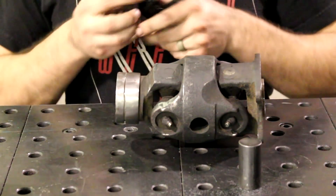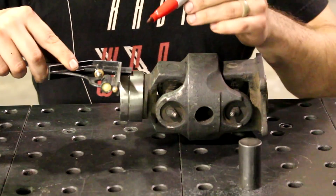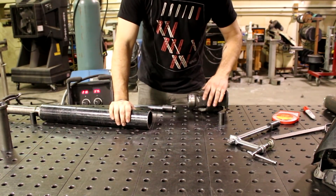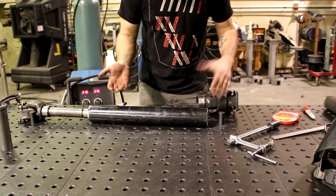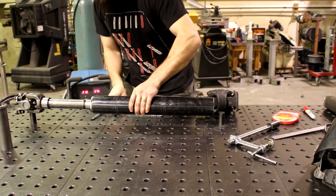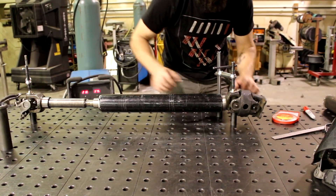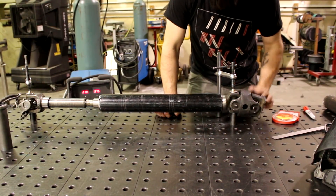Let's put the other end on. On the double CV side, to ensure that this is going to sit in the pipe level and not be off-center, we're going to take this, set it to a half inch, and mark a line all the way around here with red sharpie. A very important thing when building a driveline — whether it's a square driveline or using a kit like this — is you want the yokes on both ends to be aligned. The easiest way since we're on a jig table is to set the bottom of the U-joint in the peg right here, clamp this down, and rest this end flat — so both yokes are perfectly flat. The only play we have now is a little bit of left and right, and our red line is what's going to help us stay true.